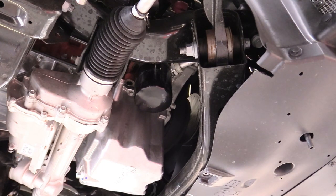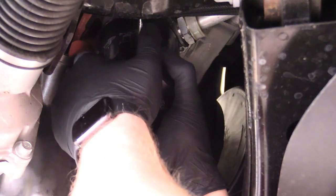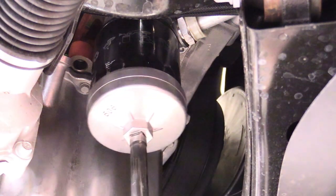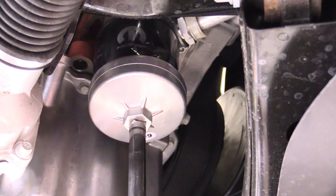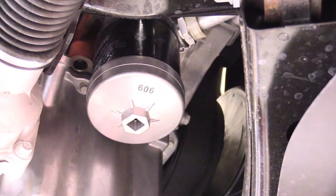The filter is in front of the passenger seat — pretty easy to find. On more high-performance vehicles they usually put the oil filter in a difficult spot, but this one is nice and convenient. Get your catch pan ready because oil is going to come out. This one's from the factory so it's on pretty tight — you can use an oil filter wrench or an oil filter socket. I have an oil filter socket here, link in the description.